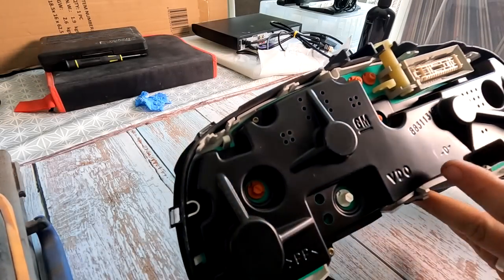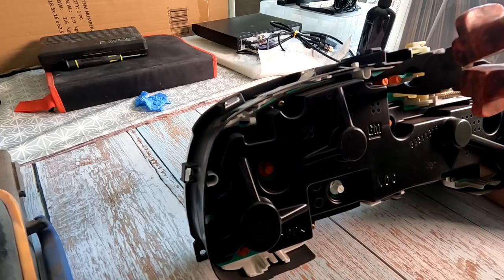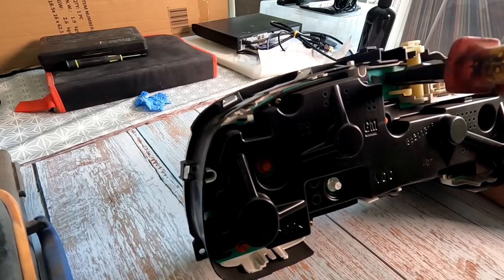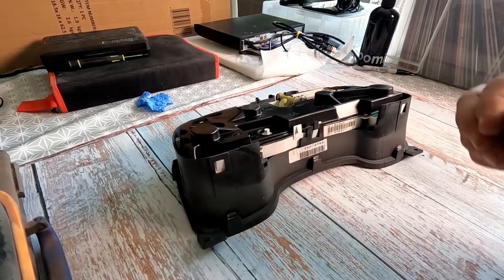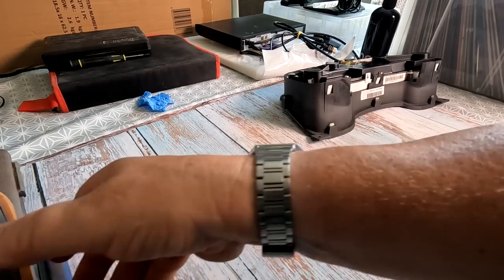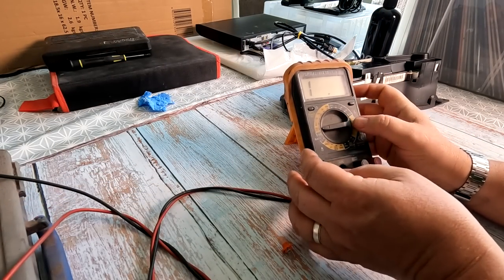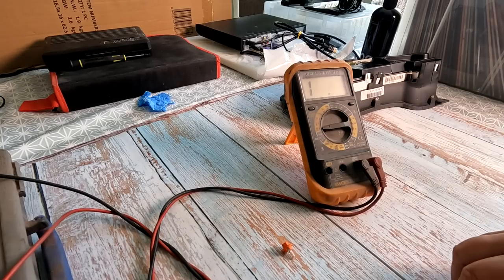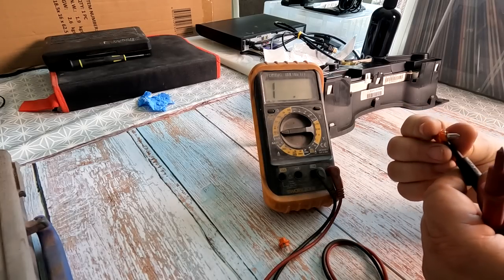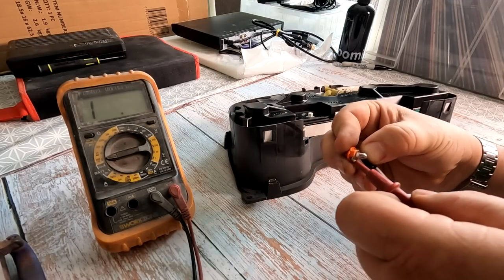So we've got the binnacle inside now. Let's have a little look at these little bulbs — they just give a little half turn and they should pull out, sort of like that. So these are them. Let me bring in my multimeter and put it on 200 ohms — that's the maximum range. Let's see what happens when we short it out. We're looking for an open circuit here, so I'm looking for this not to change when I touch that down. There's one that's open circuit.